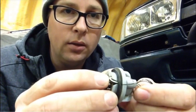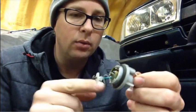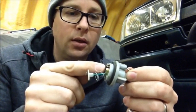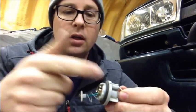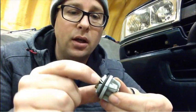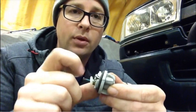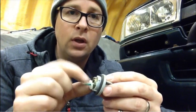So I'm going to look at how this black-white wire goes in there — it goes through a little grommet, and that's exactly where the crack is. This wire seems to do a 180 here and go back down beside the bulb socket. Because I've taken the other one apart, I suspect this is just pressed in here — a quickly made piece. They take the plastic, take the wire, loop it around, shove the socket in, and it makes contact with the outside. Over time, with it cracking, it's probably going to get some salt water in there — I do live where there's salt water on the roads in winter. Chances are the other end of this wire is corroded and not making good contact. So I'm going to separate this, rip that wire out, not rely on a friction connection, and actually solder it to this outside socket.